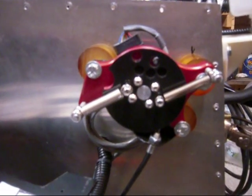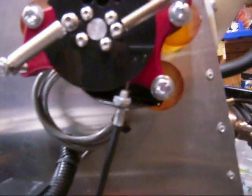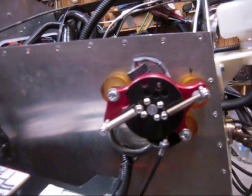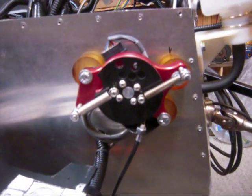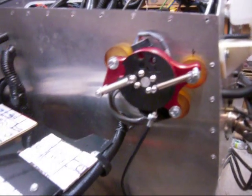What you're looking at is the throttle position sensor. There's a regular throttle cable that goes right from underneath there down around into the driver's foot pedal. When you press the pedal it's going to make the position sensor rotate. It's got dual hall effect sensors in it, which are a magnetic pickup — there are two of them for redundancy, for a system check, for extra reliability.